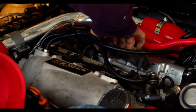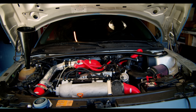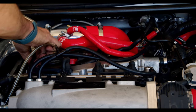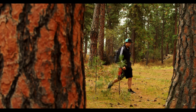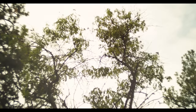About an hour later we were back where we were, priming the turbo. Emotionally, I was a mess. We need to get oil pressure to the turbo, so we need to crank the engine without starting it. I unplugged the injectors and the ignition coils, then hopped in the car. It's unnerving to turn the key in a car that's been sitting for months — but I did it anyway. And this is exactly where tensions were the highest. With everything electrically plugged back in, there was nothing else to do. The car was ready. What if this was entirely pointless? I just don't even know.